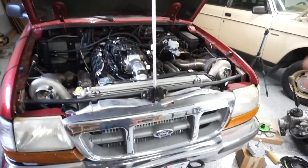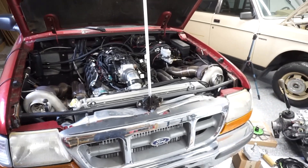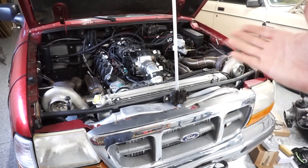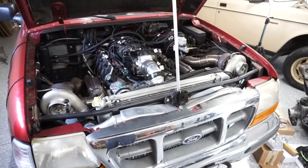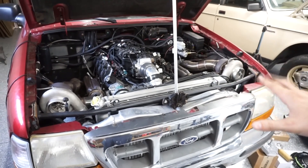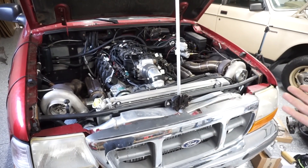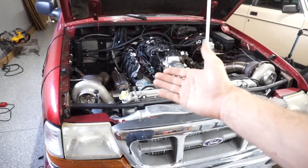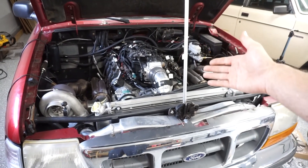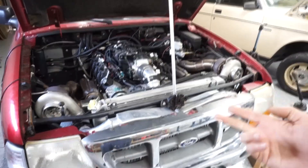The Mustang I had also had that plate blocked off, so that's another thing I could test. I'm just deciding if I really want to put the time into it because I'd have to take the plugs out and get a loop put in. I kind of just want to get to working on the Volvo. I'll make a full pass with both sensors on just to see what it's reading in boost at 6,800 RPM to get a good baseline. This is starting to make sense - both vehicles I saw 35 psi on were this one and my Mustang, and both had the water pumps blocked. That's why it's seeing 30 pounds of coolant pressure but not spitting any into the overflow - if the radiator is still at 14-15 psi but seeing 35 at the sensor in the head, that explains why nothing is going into the overflow.